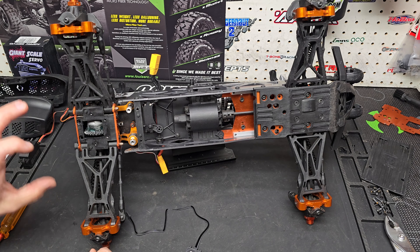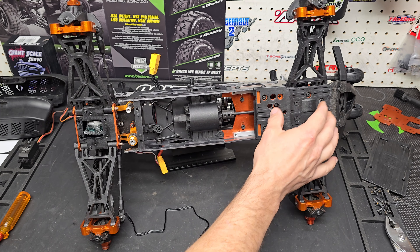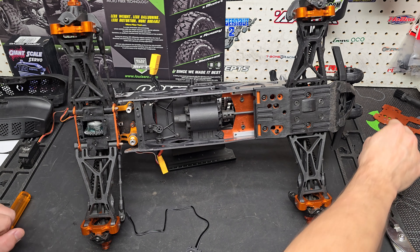Because I was removing the upper arms I had to take off a lot of the front - the front bumper skid plate. If you've got a Savage, what looks like four bolts and it'll come right out - that was not the case. What I actually had to do was pull the whole skid out at a weird bend, then loosen the screws so this can lift up a bit because it hits the edge of the chassis. You have to loosen the screws a little and then you're able to slide it out.